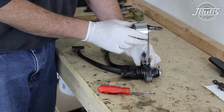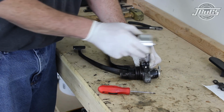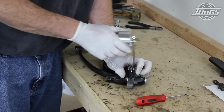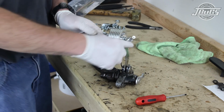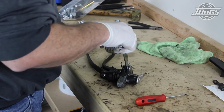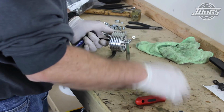The roller pedal lever isn't as thick as the stock lever, so it will wobble a little bit side to side. A few washers that fit over the pivot pin are slid under the groove to eliminate most of that play. Next, I'll use the same method to remove some of the side-to-side play on the roller pedal itself. The roller pedal is unbolted from the lever, a washer is installed over the bolt, and then it is bolted back to the lever.